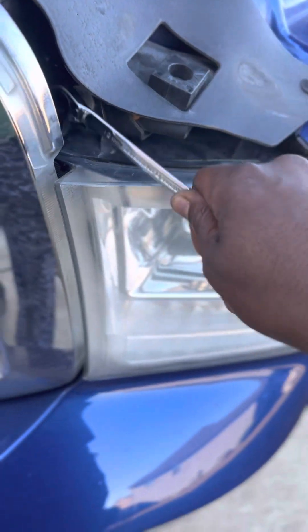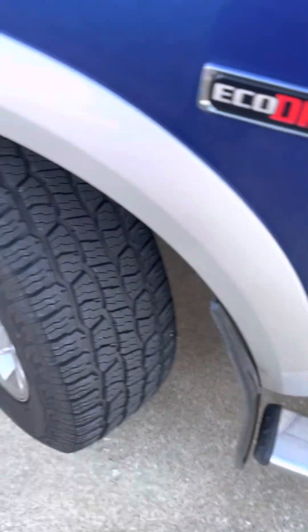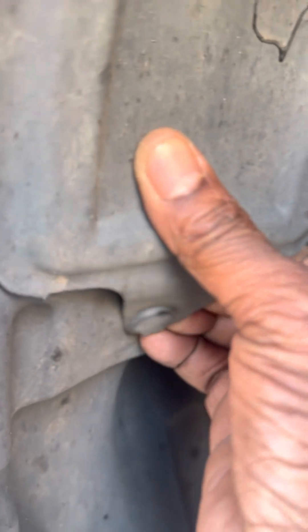The next one is right up front — I just used a little ratchet wrench and got it off real quick. Now make sure you turn your wheel always to the right, and there's a little compartment right up in here. You're gonna open it up — it has a little rivet snap-in thingy, and there's a little white clip in there. It's hard to see but it's up in there, and you're gonna pull down on it to release the light from the back side of the lamp.